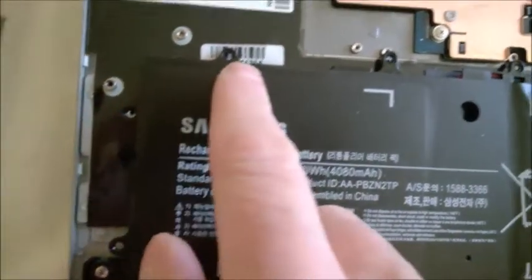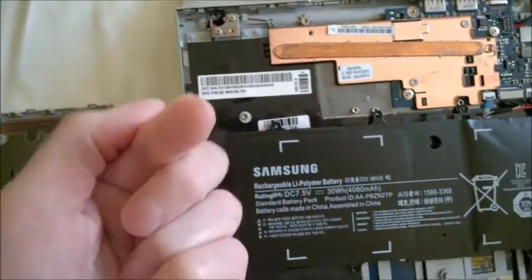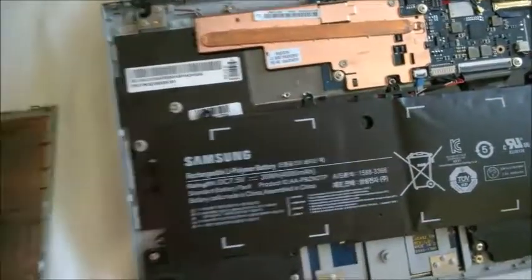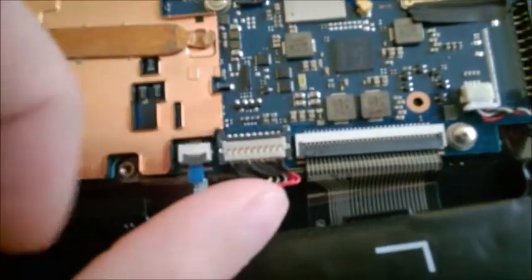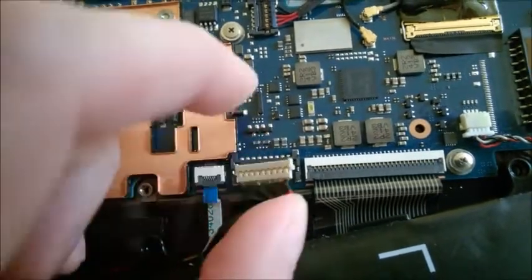The battery has six screws and the screw holes are only the ones with metal rings — some of the stubs are empty. Make sure the unit is fully powered off: hold the power button until it shuts down completely. Then gently rock the battery a little bit and carefully pull on the wires to remove the connectors. Lift it from one side carefully.